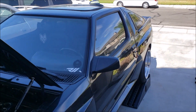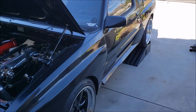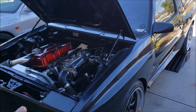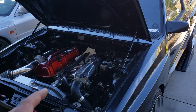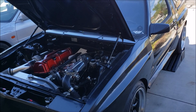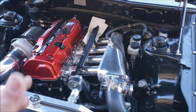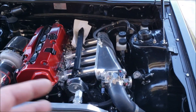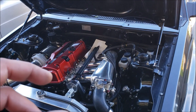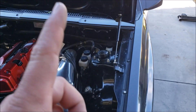What is up guys, we are back here again with the Mitsubishi Starion. We've been having fuel issues — our injectors keep getting clogged up. They got clogged up again, not as bad as the first time, but it's enough. We did remove the injectors, took them to our fuel injector cleaning guy, and he took care of that. He said they weren't as bad as before, but it's still bad. What we're actually going to be doing today to hopefully end the issue is flush out all of our lines.